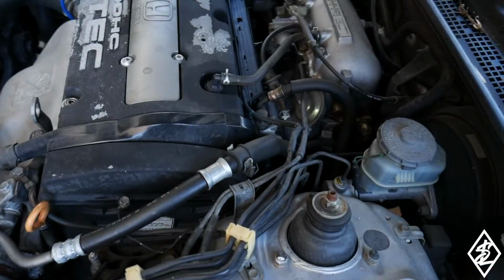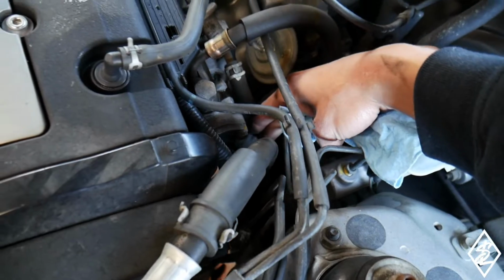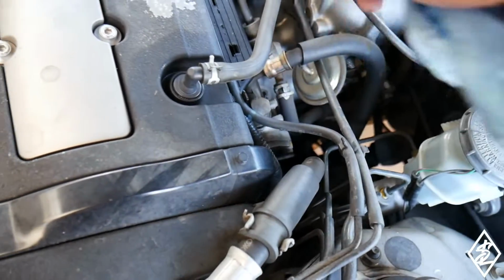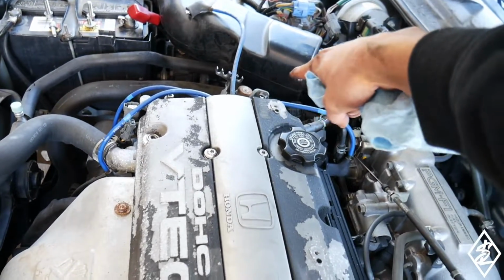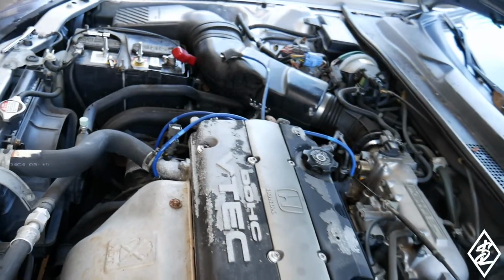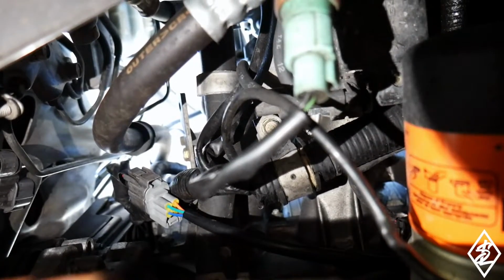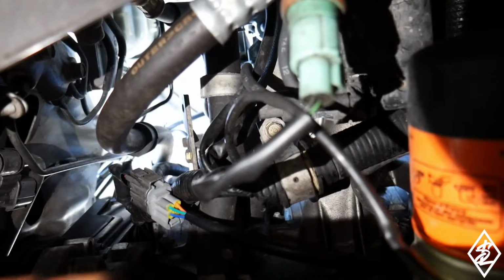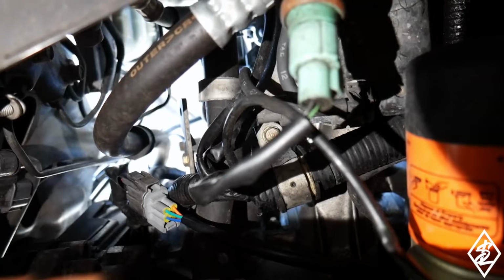So I'm going to go underneath the car and plug the wire harness into that plug that's over here. More than likely it's just going to run underneath the intake up to the distributor, some of the plugs right there, and then we'll see how it all connects. I don't know how well you guys can see, but at the bottom, that newer looking gray plug is connected to the crank sensor plug into the harness.